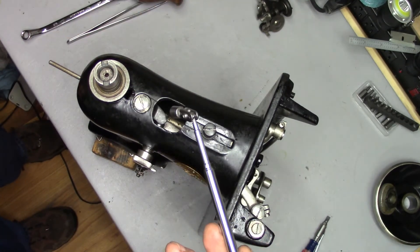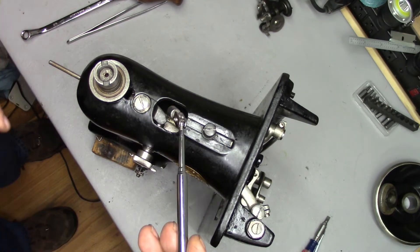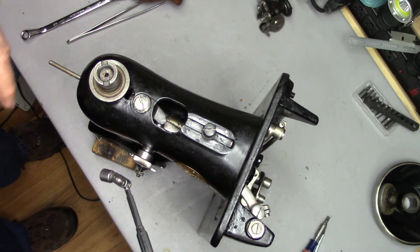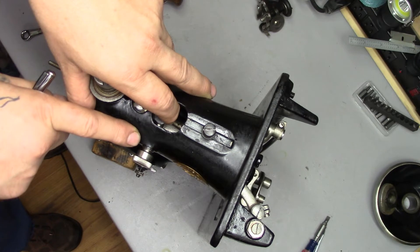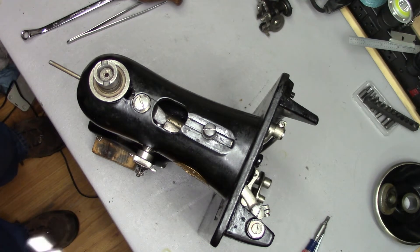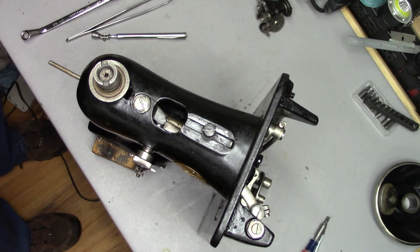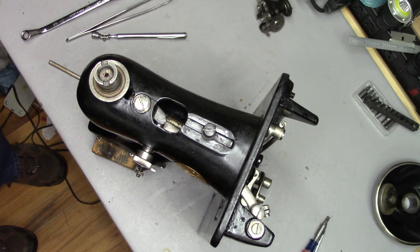Get yourself one of these magnets on a stick — they're cheap, like a dollar ninety-eight at Harbor Freight. I keep a couple on the bench. Use that on the tab portion to maneuver it in place. I'm seeing roughly two full threads, closer to three full threads exposed right here, and that's where I was able to get it in with no problem. So try that as your setting. It's really not that difficult — sort of like getting to Carnegie Hall: practice, practice, practice. I hope this helps. Keep the comments coming and I'll keep figuring out better ways to describe this stuff. Thanks for watching!